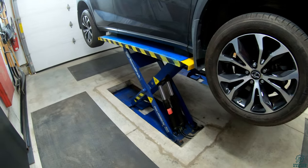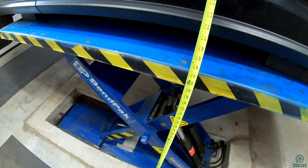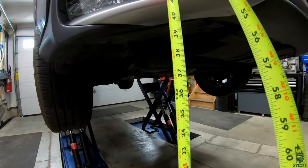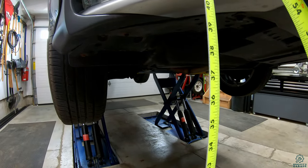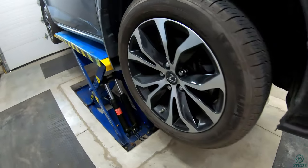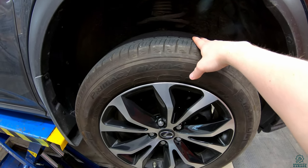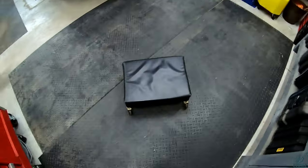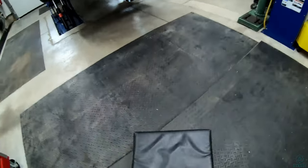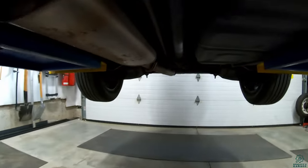At the full height the platforms are sitting at 37.5 inches. Looking under the nose of the vehicle there's about 40 inches of actual under-height head clearance, which makes it comfortable to sit underneath. The wheels are now at almost the perfect working height — roughly shoulder height with my arm stretched straight out at five-foot-nine. I built a tiny roller stool only about six inches tall so I can roll right underneath the vehicle without bumping my head, and we'll take a little trip down the middle of the vehicle front to back.